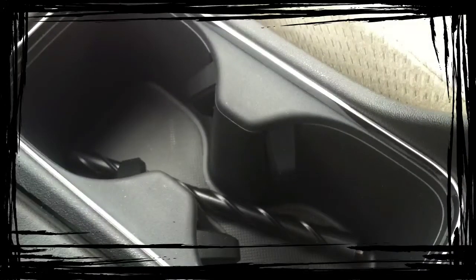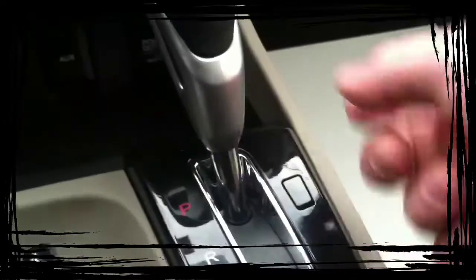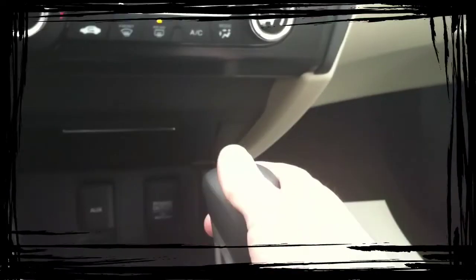Storage, obviously. Cups. This little thing right here — if this battery is dead and you want to get this out of gear, you can't get it out of gear unless you have your foot on the brake and power to the car. So what you would do is pop this cap off, take your key, stick it down in that hole, and then you can take it out of park, put it into neutral, and push it out of your garage. Have somebody jump it for you.